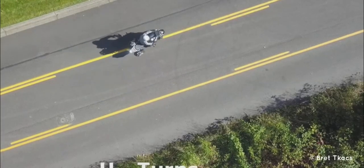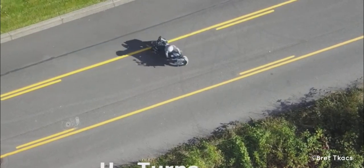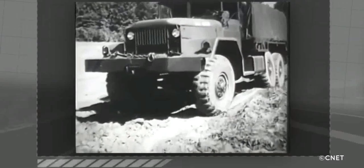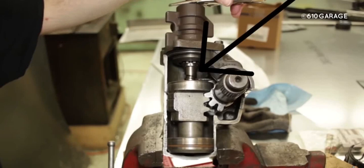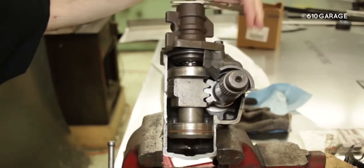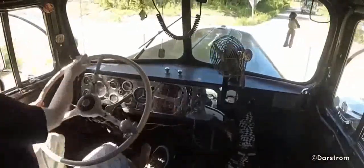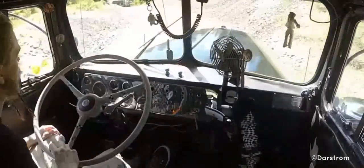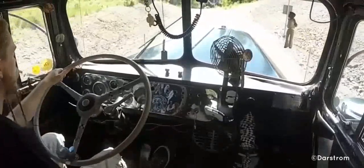Small vehicles like two-wheelers and three-wheelers are controlled by a handle, and you can easily make a U-turn with it by turning the handle just a few degrees. Earlier, this was not possible to implement in cars and trucks as it was difficult to apply so much torque to move the steering assembly. So they used to have reduction mechanisms, or you can say a gearbox, to decrease the required torque input. You might have seen this in old trucks where, to turn the tire a few degrees, the driver keeps on rotating the steering wheel to make that turn. That is due to the gearbox, as without it, it is not possible to turn the wheels by human effort.